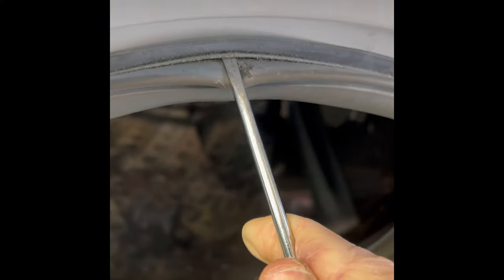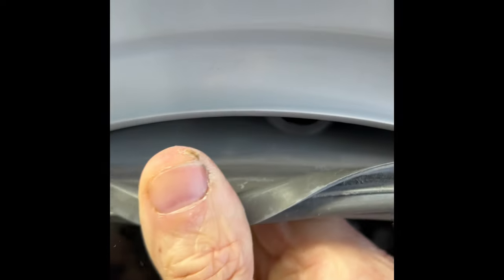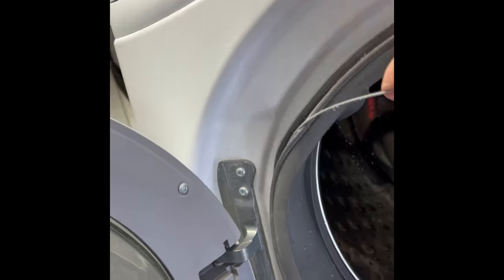To remove the door boot, take a flathead screwdriver and put it in underneath this metal ring — it's called the spring clamp — and bend it back like this. See how it's coming out toward me? Just keep pulling it and see how it comes out. That's the spring clamp, and you can pull it out from inside its groove.